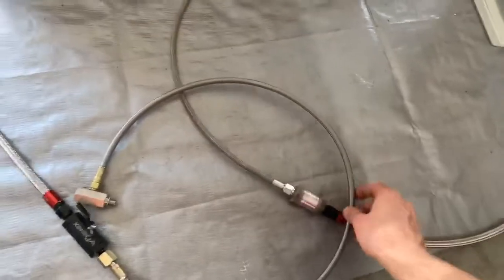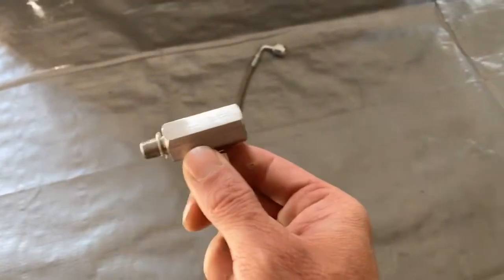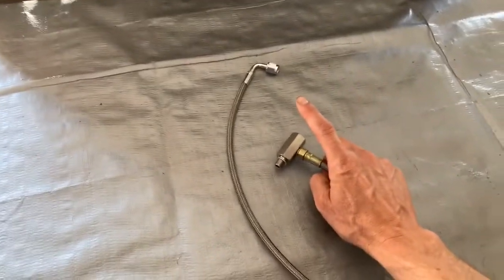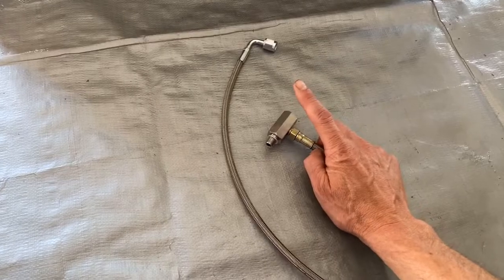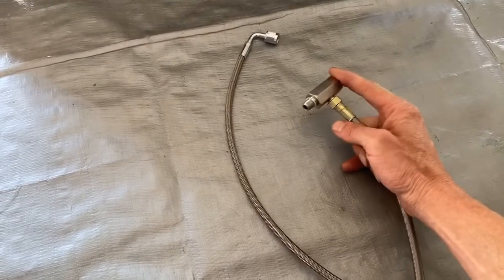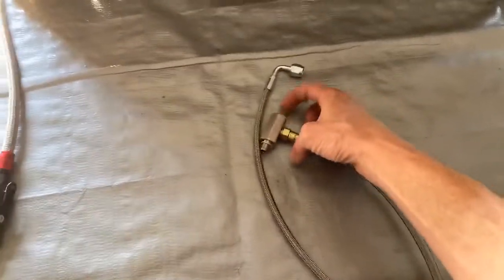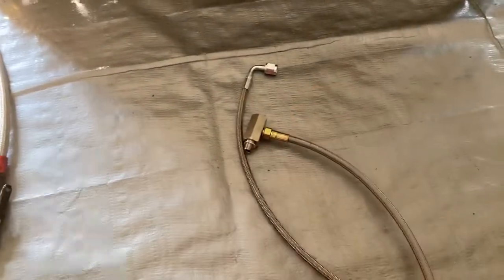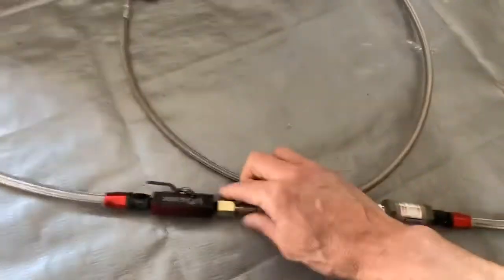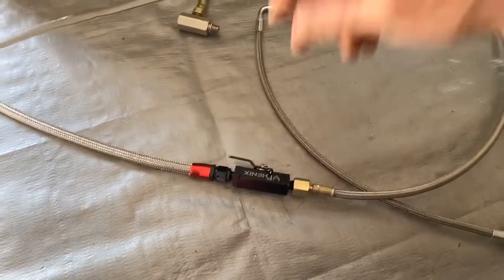Oil feed — the T. You remove your oil pressure sensor; that goes in place there, and your pressure sensor goes here. I'm going to put a little bit of the proper type of gasket maker on my pressure sensor to help keep it from vibrating loose and to help with leaks. I've been waiting for this first one — the first order got canceled. It's a simple device; there are tons of them out there, it was just a little difficult to get during this whole situation.